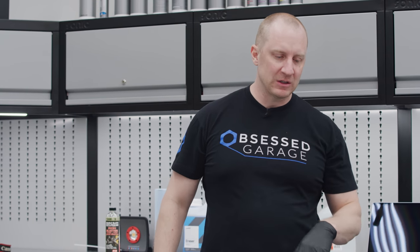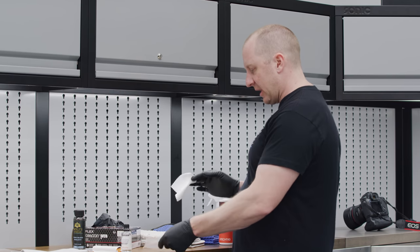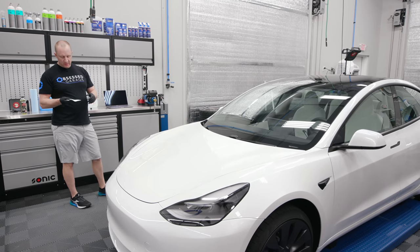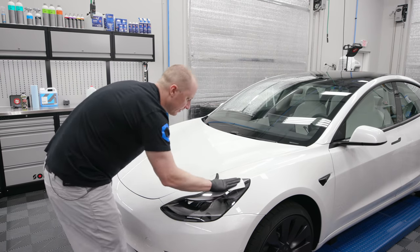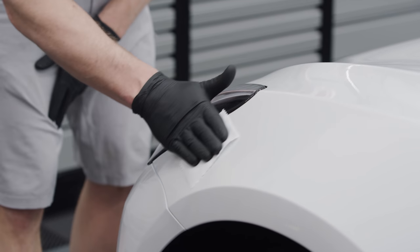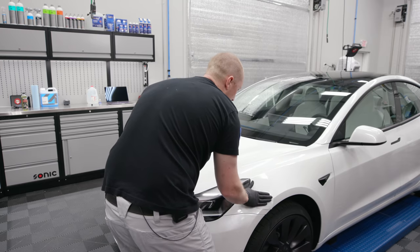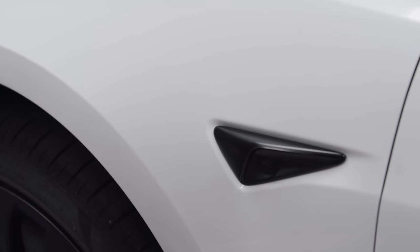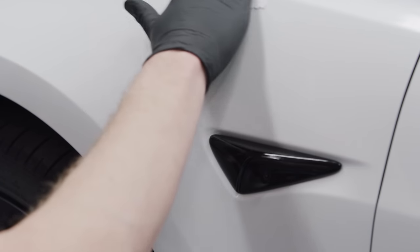If I was doing this professionally I'd darken the studio and use a few handheld or head-mounted lights. In my garage I'm not too concerned. I'll set up two applicators — one off the block and one on the block — prime it up and then go to town. This is easier than waxing. The difference is that waxing is harder to screw up — with a coating you could leave high spots behind. With wax you can come back a day later and wipe it off; with coating it's not as forgiving and you might end up having to polish it off because it sets quite a bit harder.